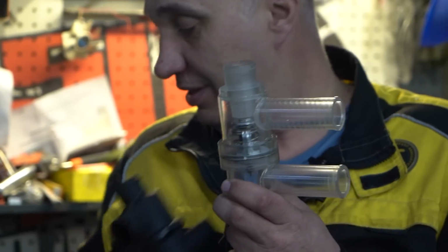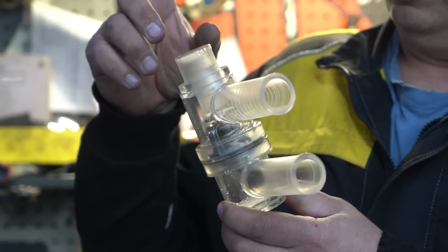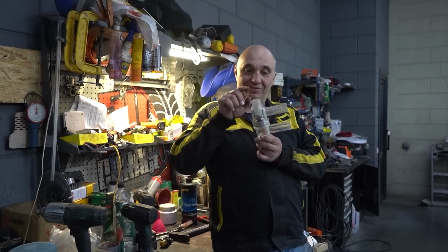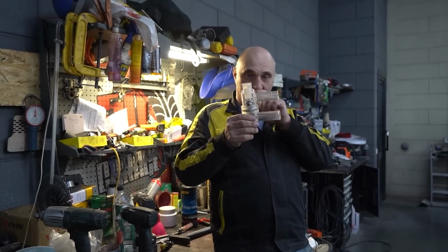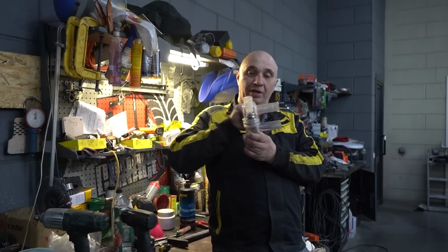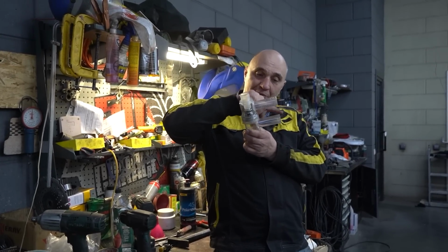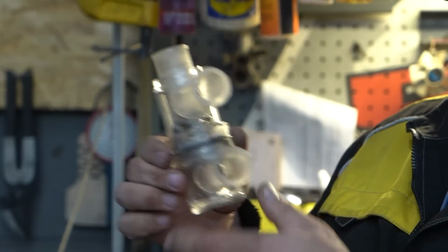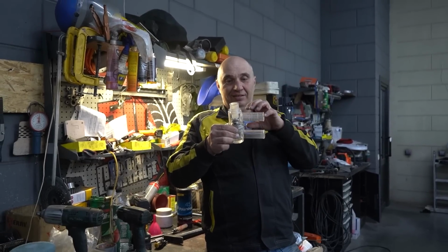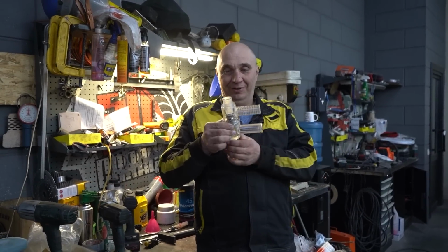And so here we did our best to replicate that effect. So this constitutes the small circle. The liquid is going to be flowing like so in that phase. But when the thermostat starts to crack open and direct the coolant to the large circle, it'll block off one of these upper ports, and the coolant will be flowing exclusively through the large circle. After that, it'll eventually cool off, close the large circle, and revert to the small cycle.